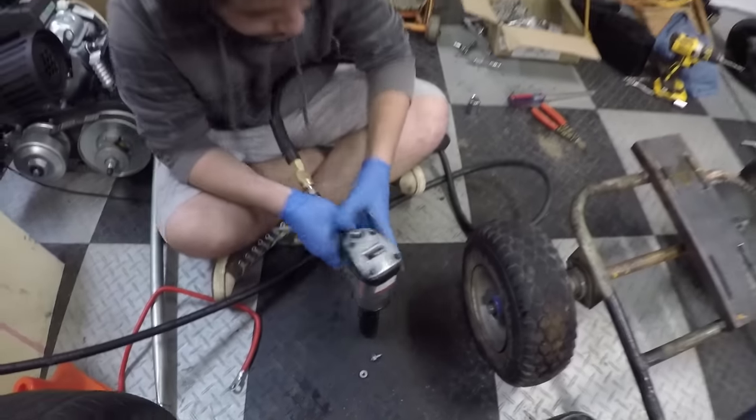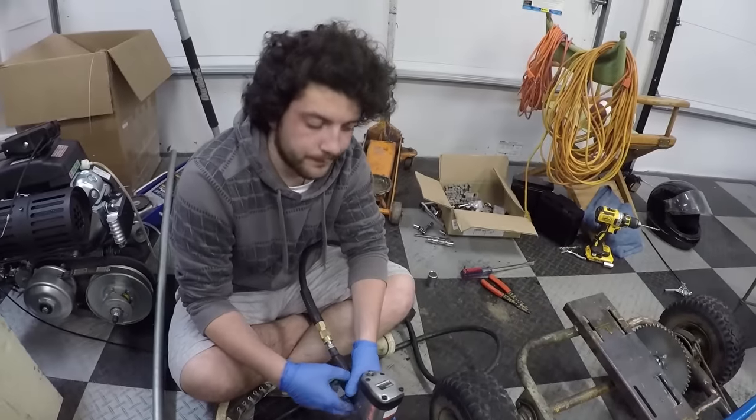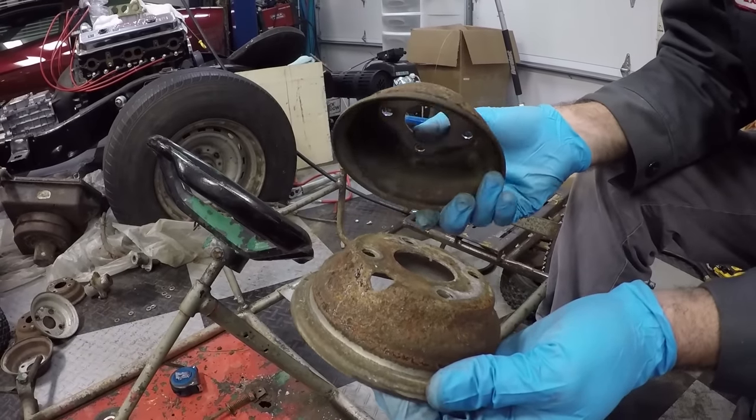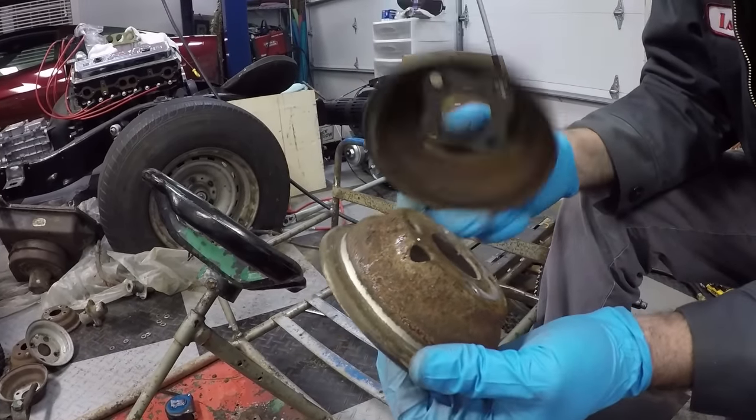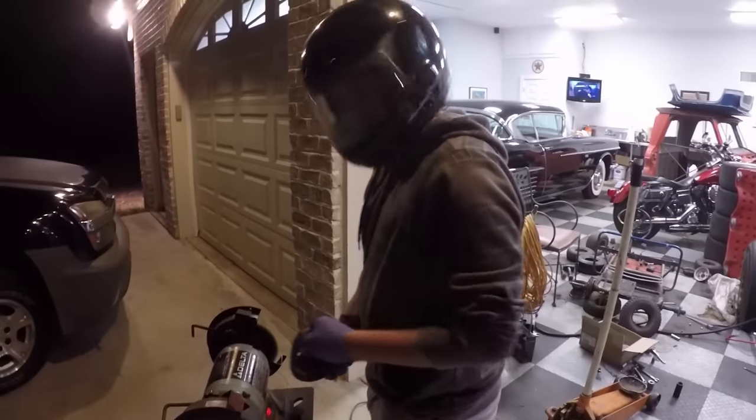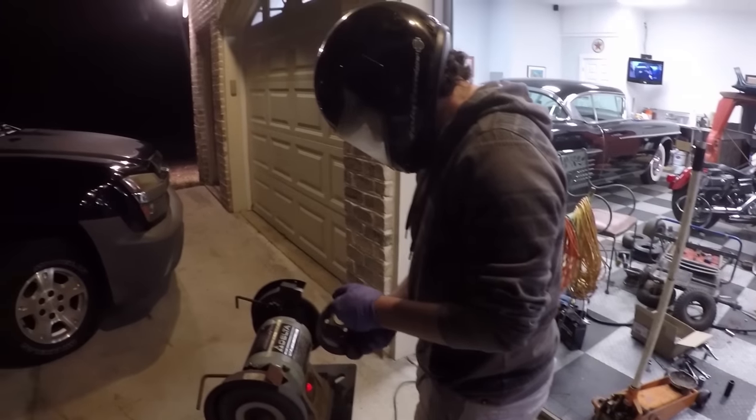She's stripped — it's not as bad though. We're having a little bit of trouble getting the rear right hub off, just like the rear left one. We are going to have to take it to my work and put it in the 20-ton press, probably with a little bit of heat, to get the hub off. We'll just take the best four out of all of them and use those. John is cleaning up the rims, getting all the rust off.